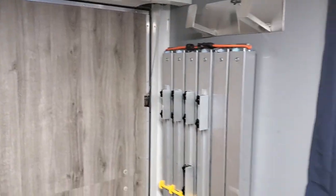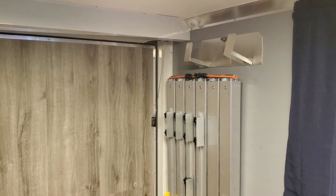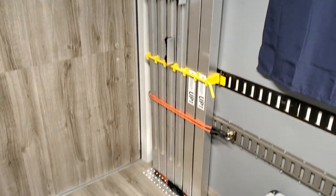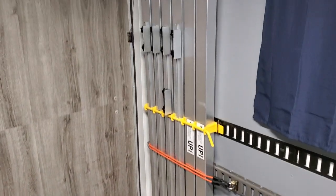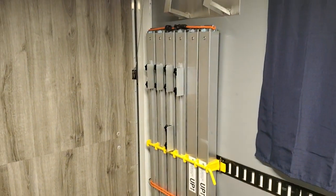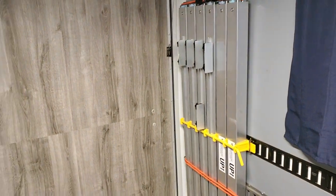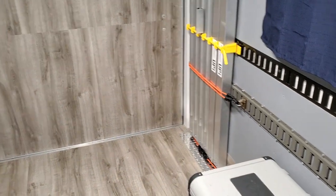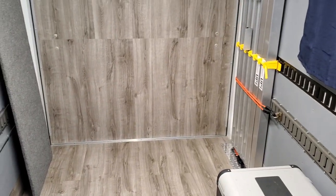On the back corner up top, those are helmet mounts so you can hang your helmets. And then you're going to see these kind of weird-looking beams. Those are called shoring beams. Shoring beams are designed for cargo trailers and they're designed to span across e-track. You can move them accordingly based on your cargo — it just keeps stuff from sliding around when you're hauling.